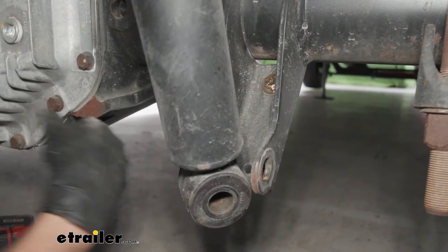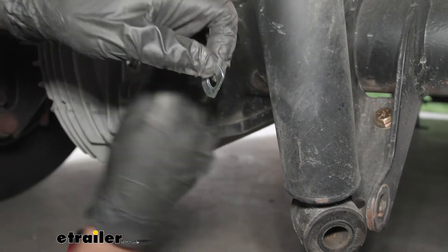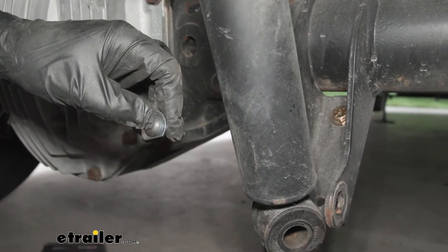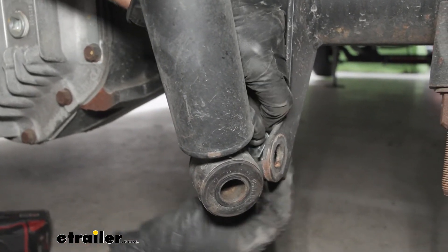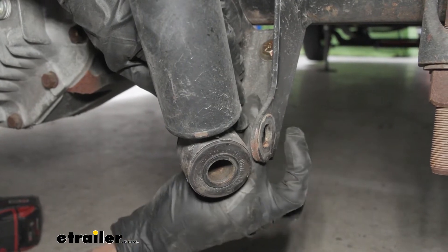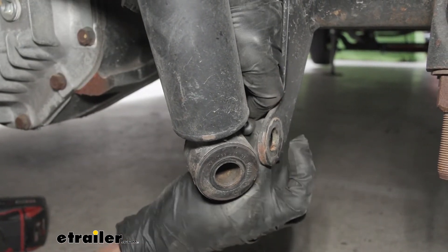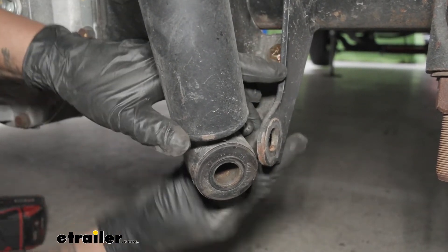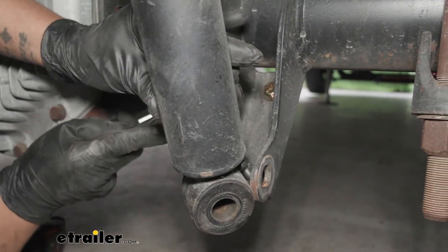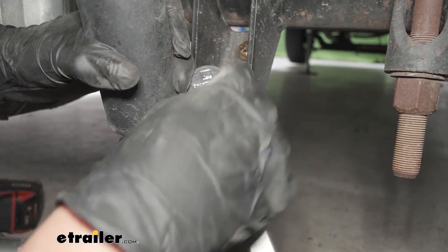For the lower hole, it's going to be a different piece of hardware. This time we want to grab the cap screw that's in our kit. We're also going to have a few washers that are cut. We want to use that washer so that it doesn't interfere with our shock when it goes back into place, because that lower hole is really close to the radius edge on our shock. Put this bolt in the lower hole, make sure that the washer is sitting with the flat section going towards the bottom so it will clear the shock. It's kind of tight, so you can just turn your finger to get it to start threading through, then grab the bottom of it to make sure it goes all the way through. If you're having a little bit of trouble getting it to turn with your finger, you can grab a 7/32 Allen socket to turn the bolt — you may have to move your shock out of the way a little bit to make it easier.